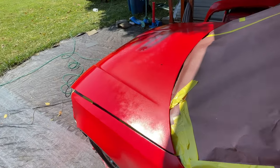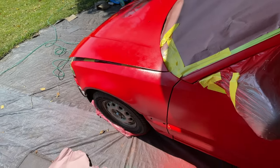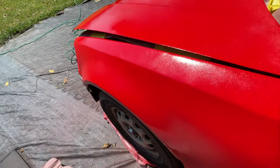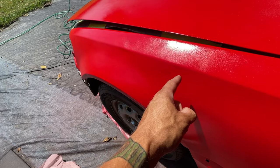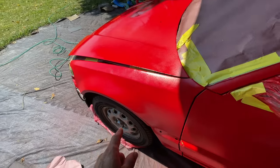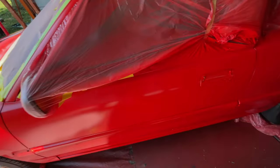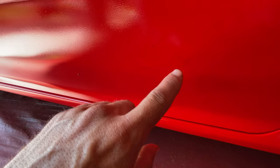The car will get some clear now. I still got to do another layer on here just to even it out a little bit better. But it turns out this was a fail — because since we ended up sanding it, apparently when we wet sanded, all the grit just stuck to the paint and after we washed it, it wouldn't wash off. So it basically seized into the other paint. We were trying to do that wet sanding just to help that clear bond, but you get streaks. It's probably because we did it under the sun and the paint was just hot.